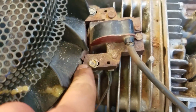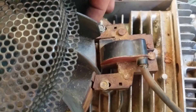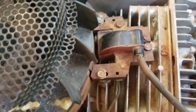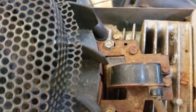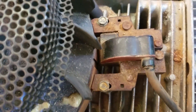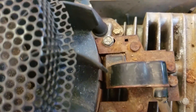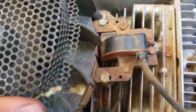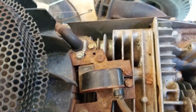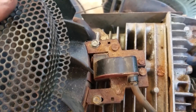So that's how you do it. Make sure you get these bolts tight, but don't strip them — you don't want the coil to contact the flywheel and destroy stuff. This will really help keep your motor running good, because a lot of guys don't check this. It's easy — it takes like 10 minutes, but once you get it set it should be good. It doesn't normally move that often. Thanks — like and subscribe if this helped you out.